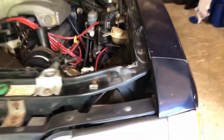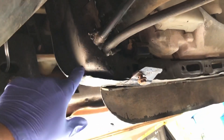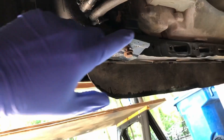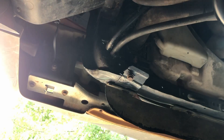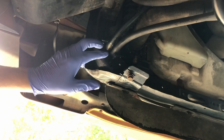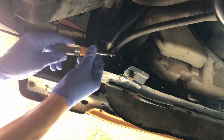Okay, that's pretty much empty. Let's go over to the side of the car. Underneath on the driver's side you'll see two hoses right here at the bottom corner of the radiator, just under the radiator hose. You have two black hoses — those are your power steering hoses that go to a cooler that sits in front of the radiator. The cooler is basically just a metal tube that runs around in front of the radiator. I'm going to disconnect both of these one at a time. I've got a big pan here to catch whatever comes out. All this is damp from leaking — I think one or both of these hoses were leaking. You need a 5/16ths to remove these clamps.